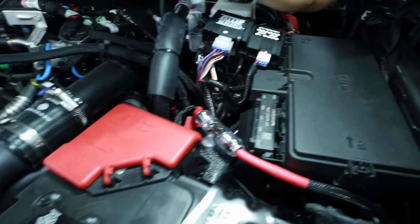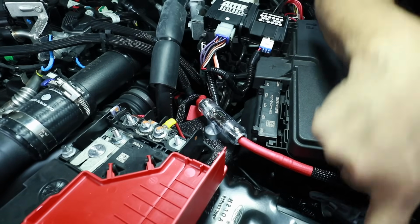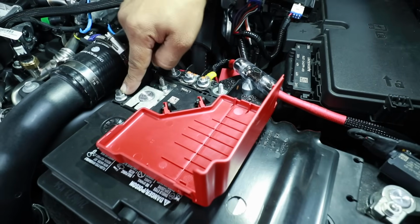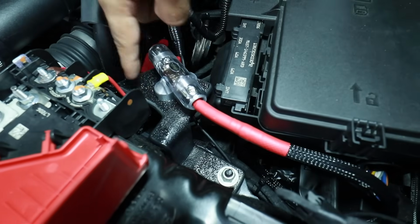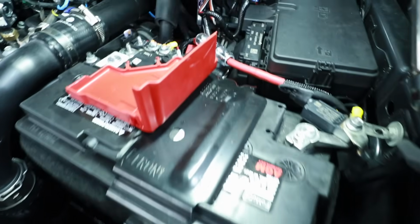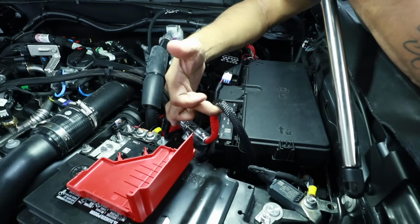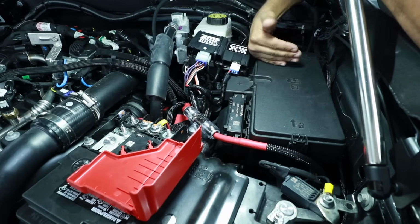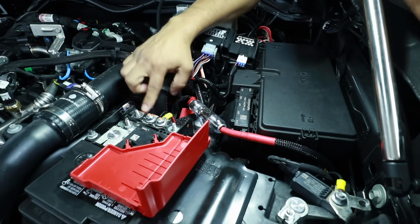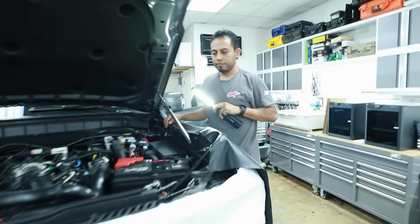There is no cutting. If somebody's going to replace the battery, the only thing they have to do is remove the 10 millimeter from the ground, the 10 millimeter from the power, the 13 millimeter where we have our fuse mount, and the 13 millimeter on the other side. This bar comes out, the whole mount should come out. This is why we have plenty of wire, because this one will move this way. They replace the battery. They don't even have to remove our power wire. So we can close it and it looks like a factory. One more thing off our list.